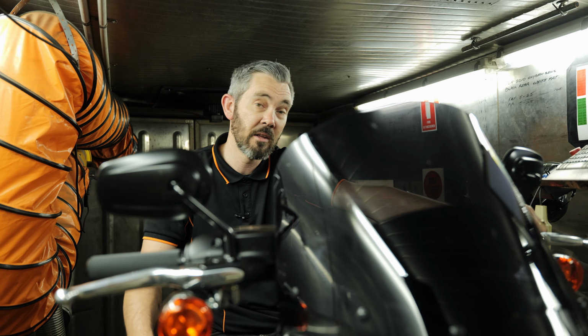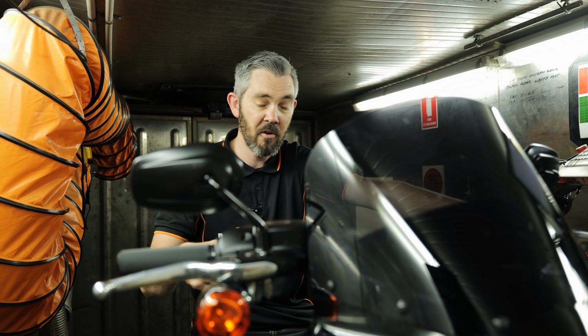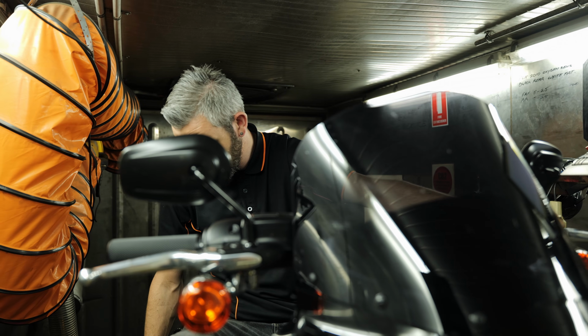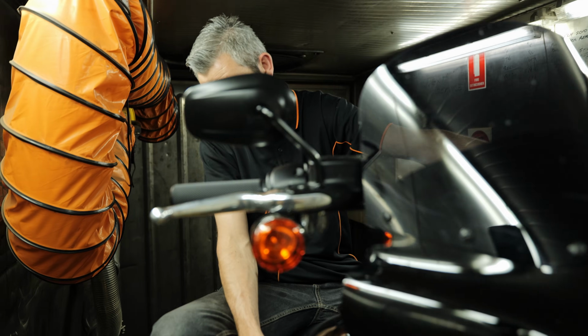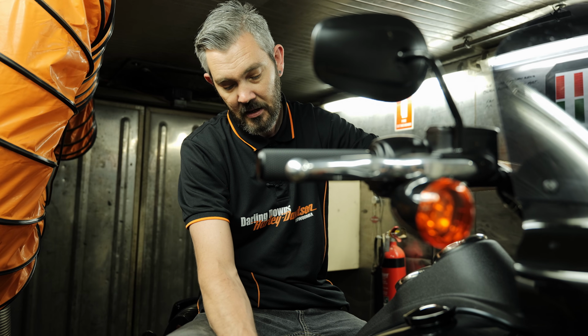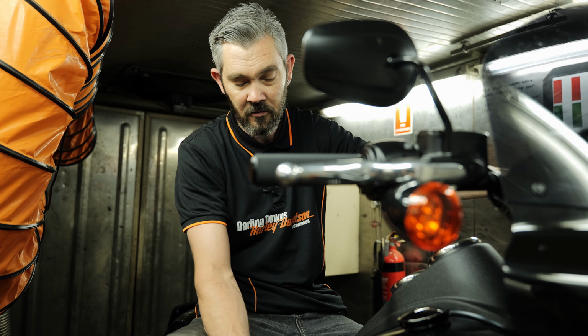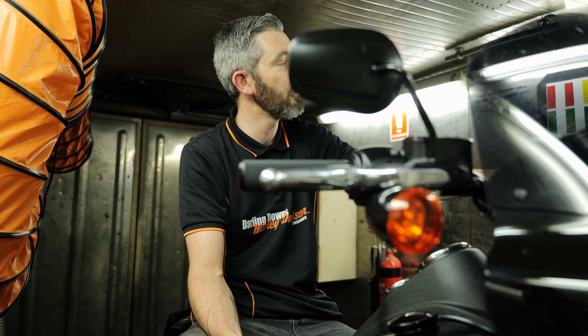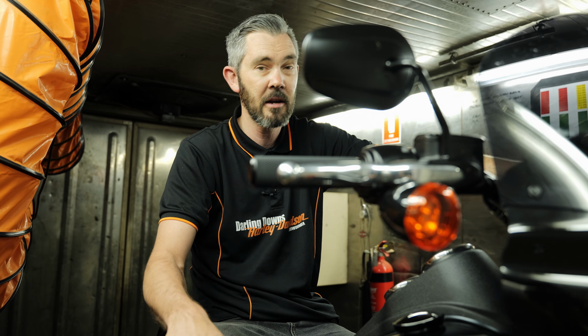We've just done the 483 camshaft, 55mm intake manifold, the injectors to suit it, and of course the Two Brothers 2-in-1. We are still running the basic upgraded air filter, the K&N replacement, rather than the extreme ventilator, which, to be honest, is probably where we would find the extra couple of numbers.